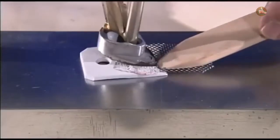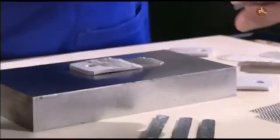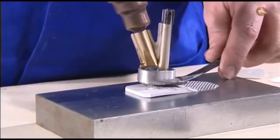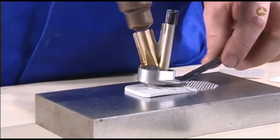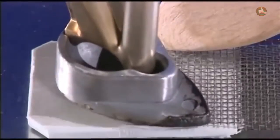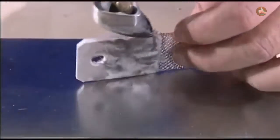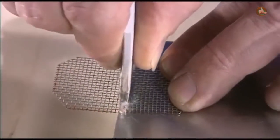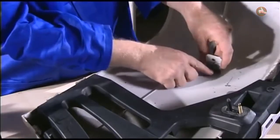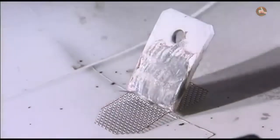Here too, take care to ensure that the plastic penetrates the gauze completely. Then carefully melt the multi-thermoflex welding rod into the substrate and smooth the material around the edges. Now for the back of the lug. Fold the protruding stainless steel gauze out at right angles. Mount the lug in the required position and weld both sides into the bumper. Tip: bend the lug slightly to the other side. It makes the work easier.